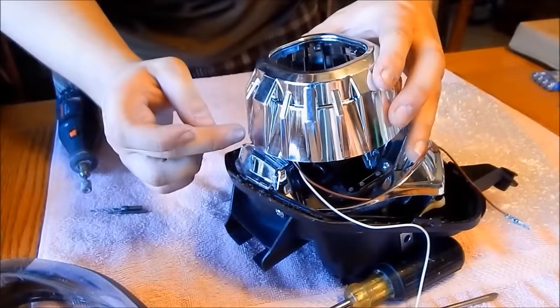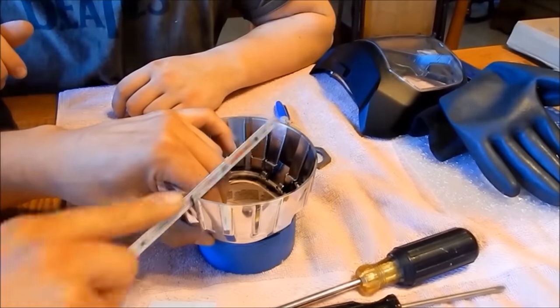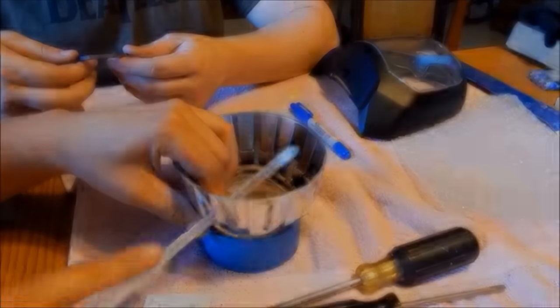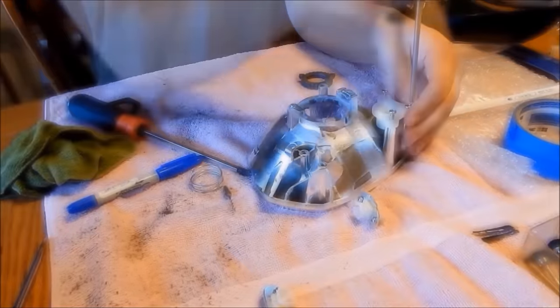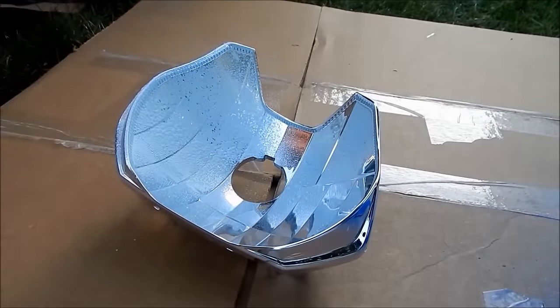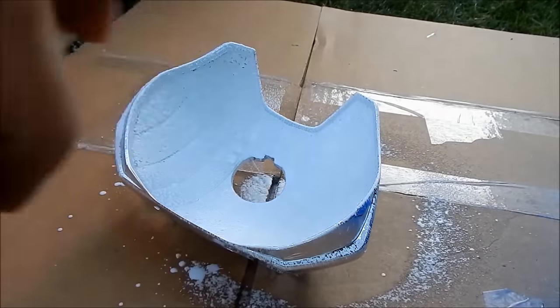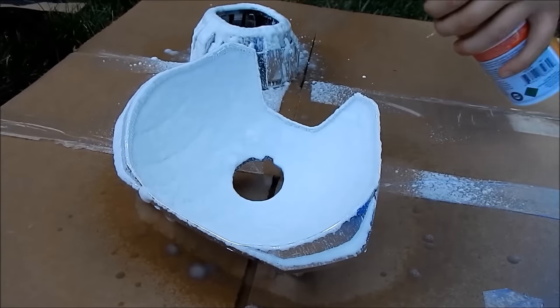Take the shroud and see where you need to cut. There needs to be a big notch cutout for the bottom parking light, as you can see here. Using a Dremel tool works a lot more effectively than the saw method, but the saw method works as well. This is what the shroud will look like after you trim it — the back will need to be ground down a bit because the reflector bowl might get in the way. Next take the adjusters off your headlight reflector bowl to make it easier to paint. Make sure to keep these in an area where you know which one goes where. If you're painting your reflector or shroud, use oven cleaner, liberally applying coats and letting them sit, reapplying as necessary until all the chrome is off. If you're not painting, you don't need to worry about this step.